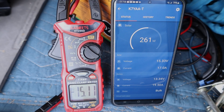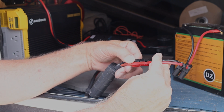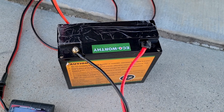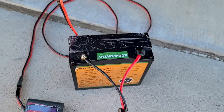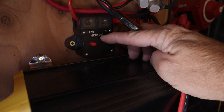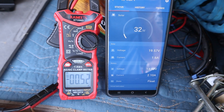By adding these three charge meters — whether monitoring on the cell phone, watching the PowerWorks precision meter, or looking at the power clamp meter — that gives me a pretty good idea of the consistency of the charge going in, and I feel good about the reliability. For lithium batteries to be charged, they need something to wake up the BMS and keep it going, which is usually a two-stage process in the charger. So let's get this thing charging. I've got 15 amps, and that's going to range between 17 amps down to 8 amps as the cycles continue. I'm going to record this for a while so you can see the peaks and the valleys.